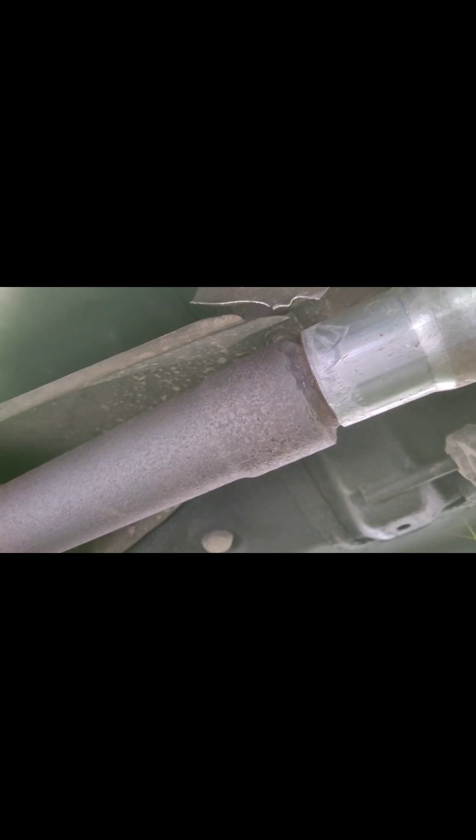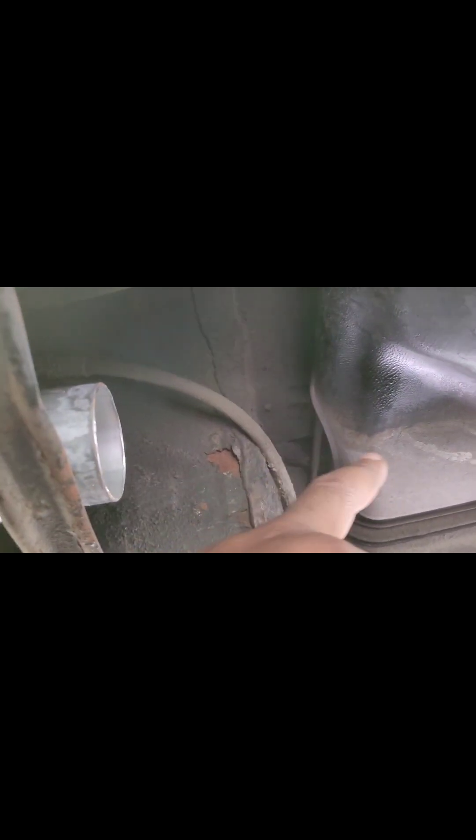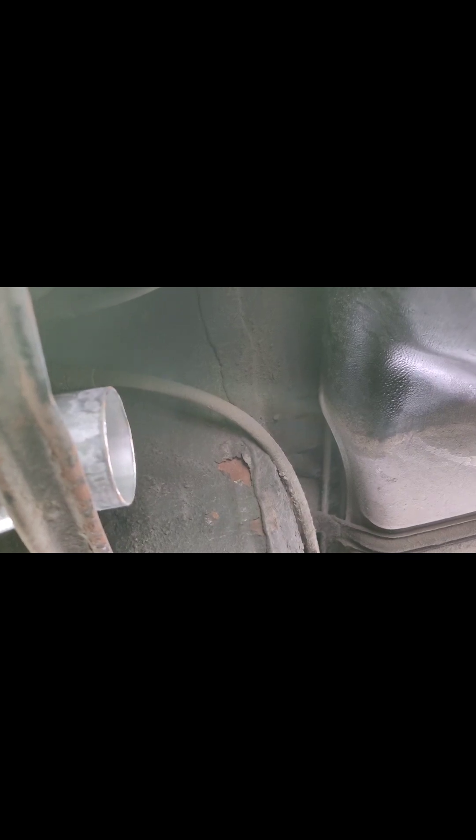You can see that fits very nicely on there — that's where there'll be a clamping point. There's a cat up in there that was replaced recently. That's just what this rust belt does — it destroys everything. Anyway, that's another surprise I gotta fix — rust repair, but not today. This is the muffler situation. We're gonna measure from this resonator right into this pocket here, then go up and over that axle — that's gonna be the trickiest part.